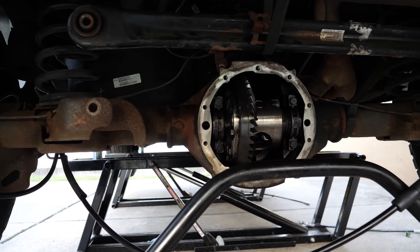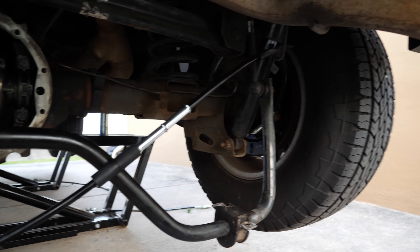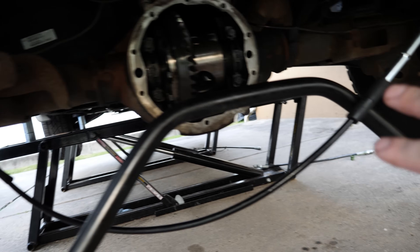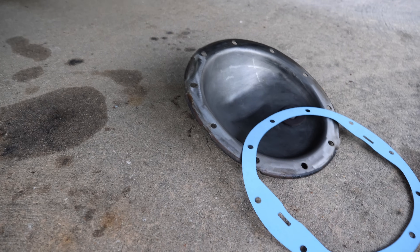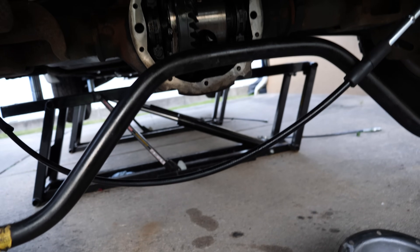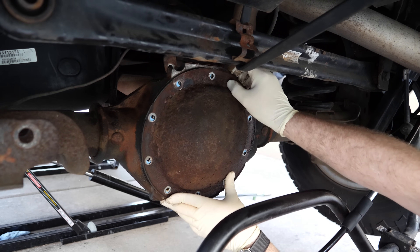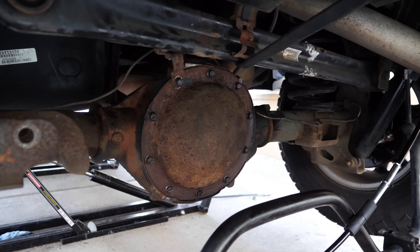That's like 17 inch pounds. Now with the torque wrench, watch as I rotate this — that's the number we're looking for as it's spinning. All right, so I got everything back together. The caps are torqued down for the diff, got the driveshaft on, got the parking brake adjusted, got the calipers back on. All that's really left to do is pop the sway bar back up, situate the parking brake cables and drop the panhard bar back in. Before we do that I'm going to put the cover back on — got it all cleaned up, got a nice new gasket. We're losing daylight quick so I want to get this thing filled up and at least spin it over to see if the noise is gone. I got the C-clips in, got the little 8mm bolt through.